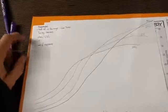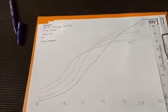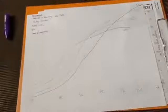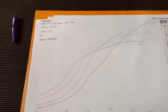Okay, so in this, again, we've covered about being too big, and then the maximum revs that our engine can turn to, what rev range we want to optimize our power. And okay, let's look at things like VTEC and VVL, and how do these engines work where they've got two different lobes on the camshaft. Well, they're basically the best of both worlds.